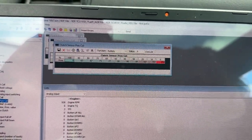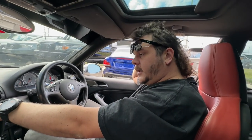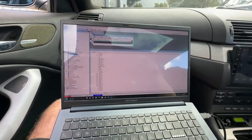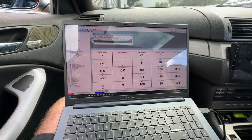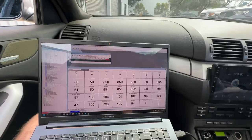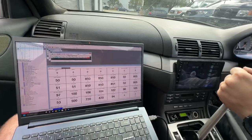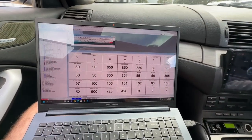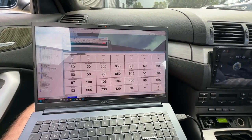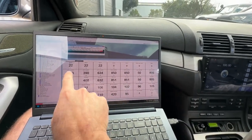These values here indicate how much pressure is going to the clutches when you're trying to move forward. So what we did is go back to our dashboard so we can see our clutch pressures. Dashboard, and then we go clutch pressures. And here, I push the clutch in. We go into second gear, second two manual we're in. And then we just let the clutch out a little bit. And you see whereabouts the pressures are at as it starts to give us a bit of forward drive? So there we go. So that's these pressures along the top.